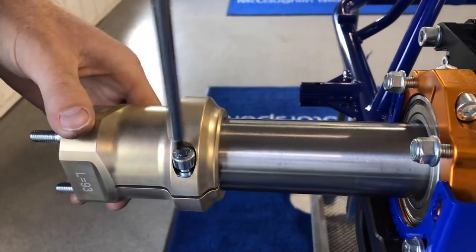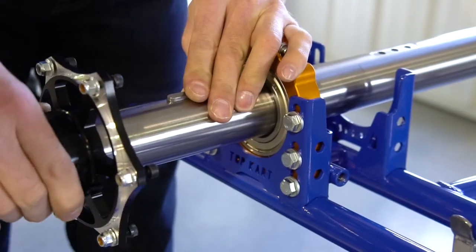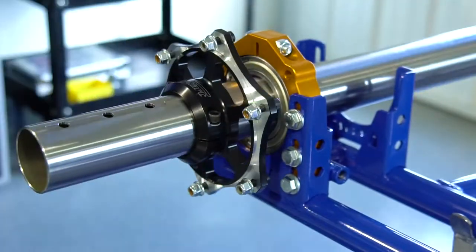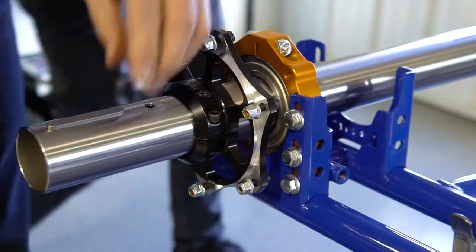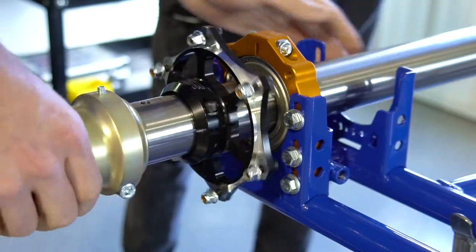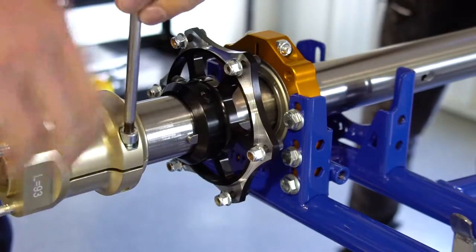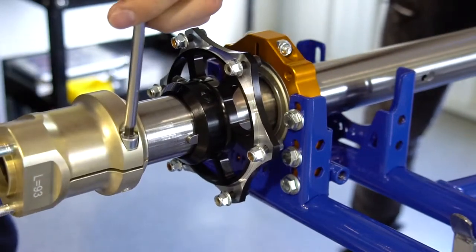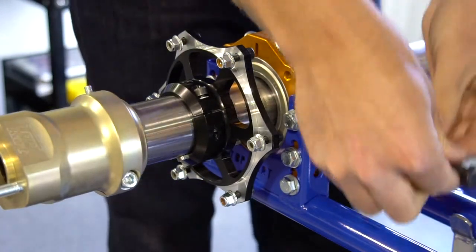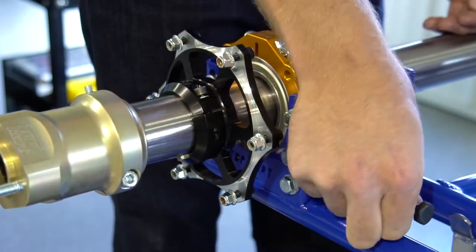As a baseline, you can just push the hub all the way onto the axle until it stops. On the motor side of the chassis, you will first need to install the axle keyway and sprocket hub before repeating the process of installing the other keyway and wheel hub. While you're working on the back end of the chassis, you might as well take the time to do the simple install of the motor mount stop bolt to finish out this segment of your cart build.